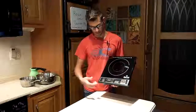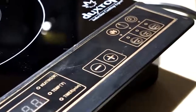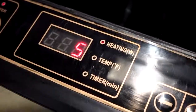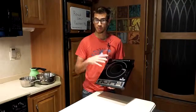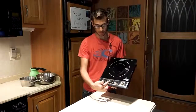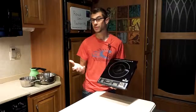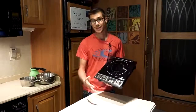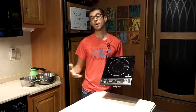The unit is incredibly easy to operate. It basically has one big on/off button — once it's plugged in, push that and it fires up. It has plus and minus controls that can adjust either the power or the temperature. On the power setting, it has settings one through ten, which the documentation says is about 200 watts up to about 1800 watts. It also has a temperature setting where you can set the temperature you want your pot to maintain — it will read the temperature on the screen and maintain it, which is great if you don't want something to boil. The last setting is a timer, so you can set something to cook for a certain amount of time and automatically shut off.